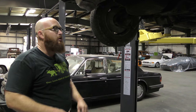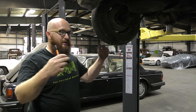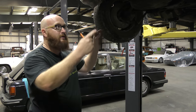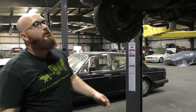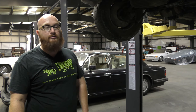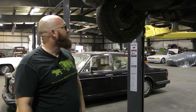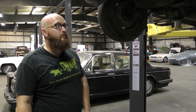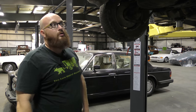From looking at this car and checking it over on top, I can tell that it's been outside for a number of years because it has leaves and things, and also mice had been inside as we've seen. Another thing you have to watch out for on a car that sits is flat spots on the tires and also age on the tires. As we get looking at this, you're going to see the tires are cracked really bad. These are not going to be tires you're going to drive on — they need to be replaced as part of getting this car back on the road.